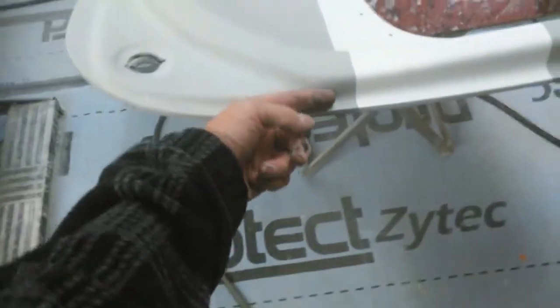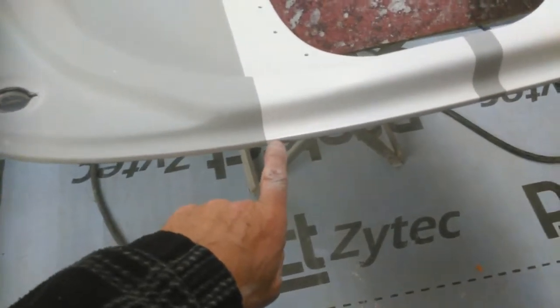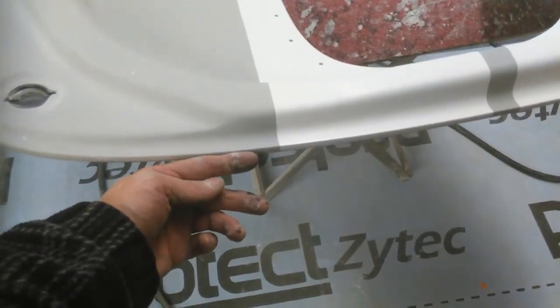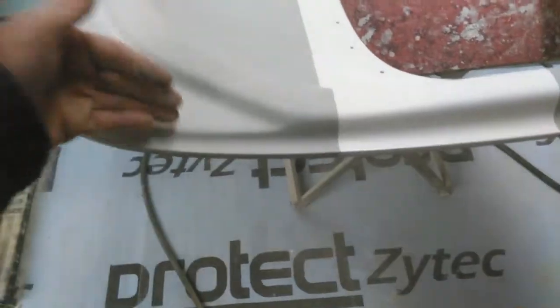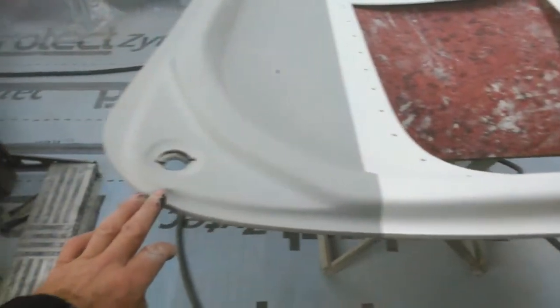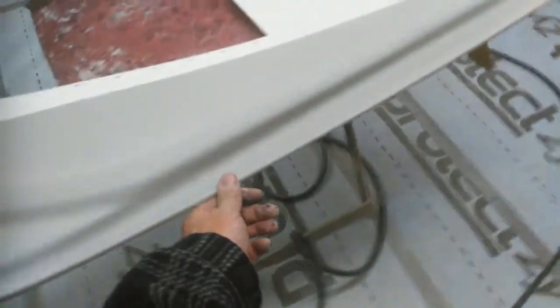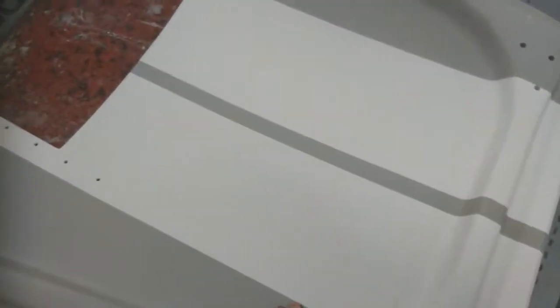Where I've nicked through, I'll puff a little bit of base white on there. I'm going to bring the blue up and around that corner so it blends around with a soft edge from underneath with the tape. There'll just be a small amount of polishing around this edge. If you analyze it you might just be able to see the edge, but I think it's going to be good enough.